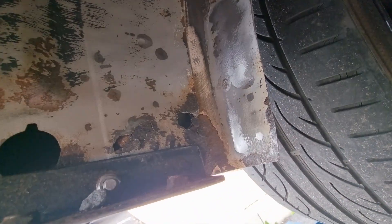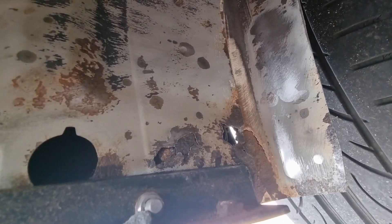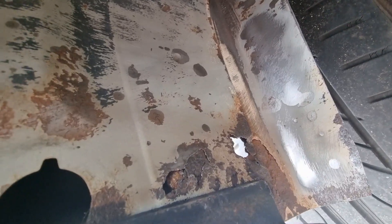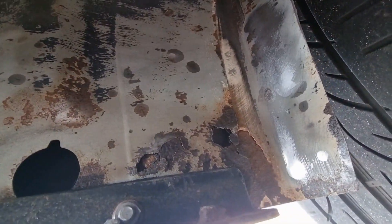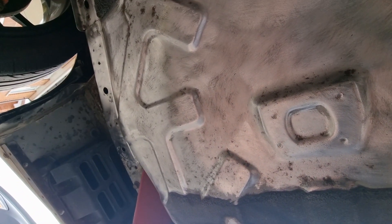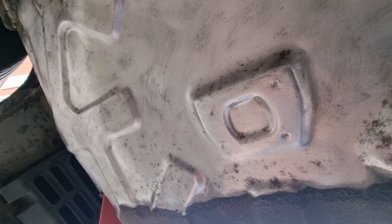I'll get these done. With the wedding coming up I haven't got the money just yet to get the welding done, but I will. So next step is rust treatment — I'll let that cure, it takes an hour or two. Then I think I've got some stone chip — if so I'll do stone chip first and then underseal.